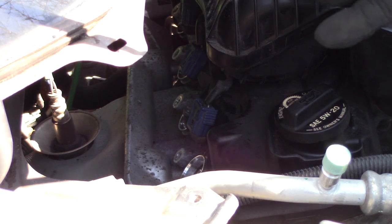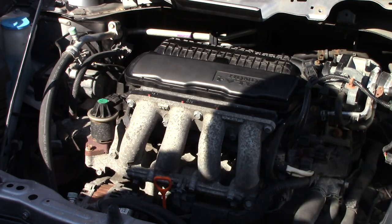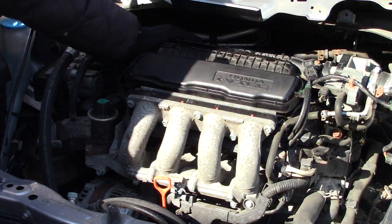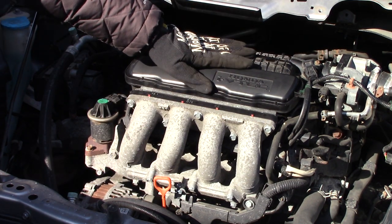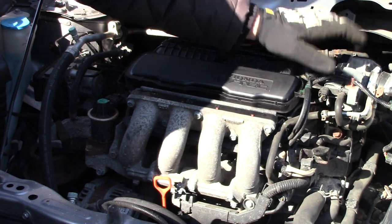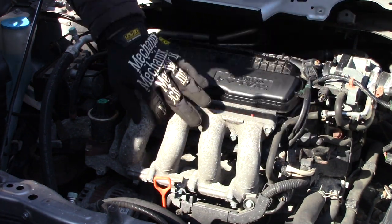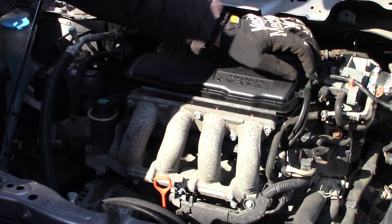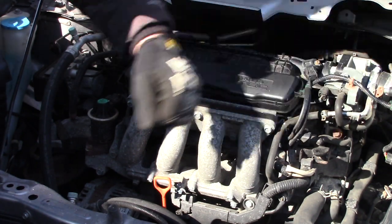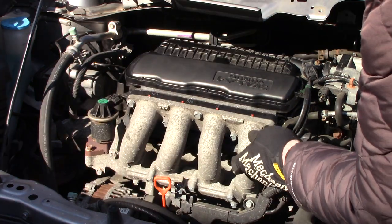Using a 10 millimeter socket you can take out the coil packs. I had to grab a magnet tool in order to get the spark plug out from the cylinder, but that works as easy as it can be. Next, after getting the spark plugs out from back here, we're going to have to take off this whole entire black plenum on top. That means we're going to have to disconnect the throttle body and the bolts over here. There are a couple of little clips, but those are pretty easily removed by just pinching them from the bottom and pulling out. These are all 12 mm bolts.